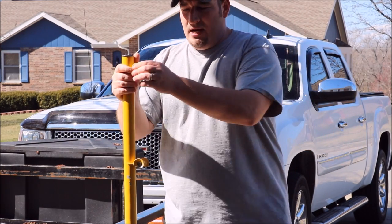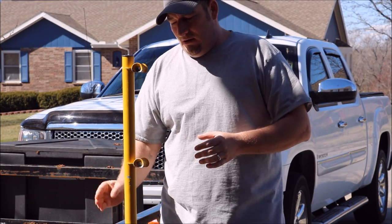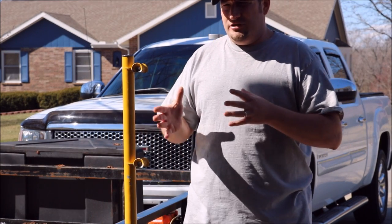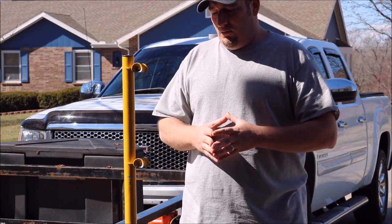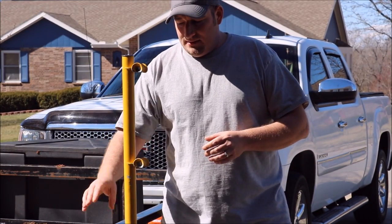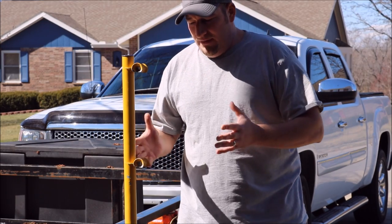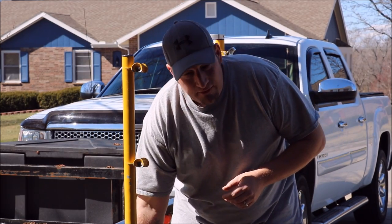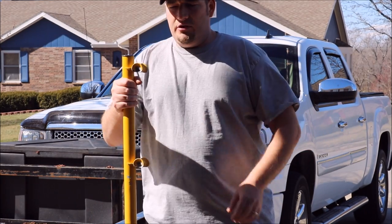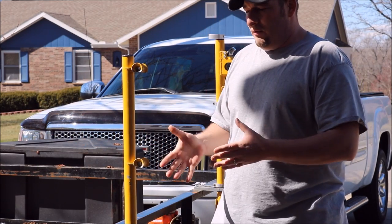But I absolutely love these racks. I'm going to tell you my pros and cons and how this rack works. A bunch of people mount this on top of the trailer. So the bottom mounts right here — this is the hardware they send you to mount it inside your enclosed trailer. I used this hardware to get creative and mounted it directly to the side of my trailer. I marked my holes, drilled my holes, then they send you an L-shaped bracket that comes with the kit. I just screwed it into the bottom of my trailer and mounted it on top of that. So if you mount it on the very top of your rail, you're going to get sway. With this, you get no sway whatsoever.